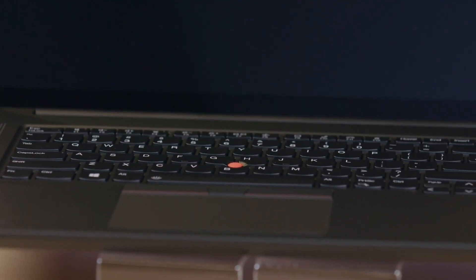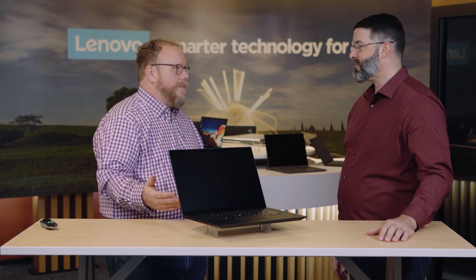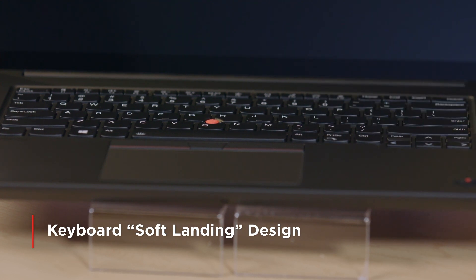Everybody knows and loves the ThinkPad keyboard — reviewers have lauded it for many years — and we've tweaked this one just a little bit. The keyboard has a signature typing action, but one thing that interrupts the smoothness is if a key is pressed hard enough to bottom out on the keyboard assembly — you get that hard landing. What our team did, and I think it's pretty ingenious, is use the Mylar sheet employed for spill resistance: it has a little cutout underneath it with a corresponding pillar under the bottom of the key. So when you press all the way down, even really hard, it doesn't bottom out against metal — the Mylar sheet acts as a tiny trampoline for a soft landing and then pushes back up.